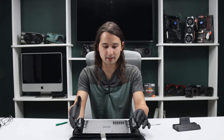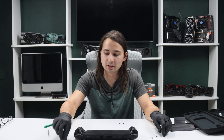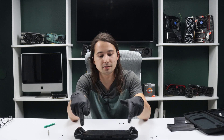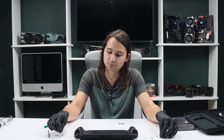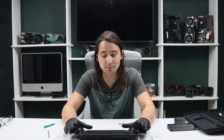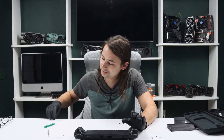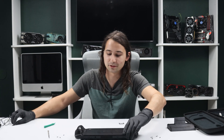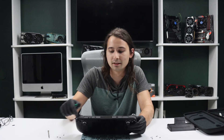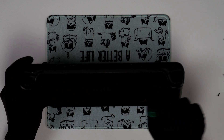Another thing you can do is put your Steam Deck in the carrying case to keep the analog sticks safe from constantly pressing up and down. Unfortunately it's really hard to see inside that case. Once you have the eight screws in the back out, remember the long ones are on the outside edges and the short ones are in the middle — four screws in the middle that are short and four screws on the outside that are long. Before you go to take the back plate off, make sure your SD card is out, or it will be snapped in half. Check it twice, four times — make sure the SD card is not inside or you will snap it in half. I like to start at the corners around the R1, L1, L2, R2 buttons because they have a nice gap in them to begin with.